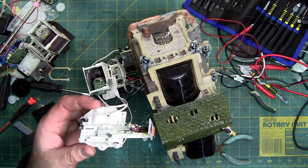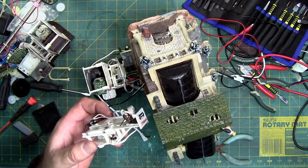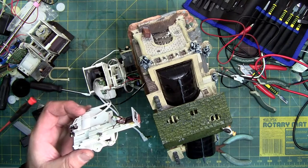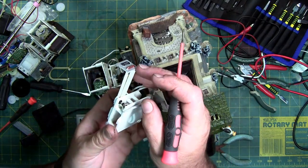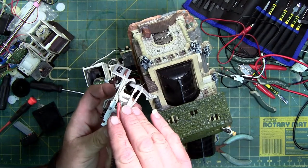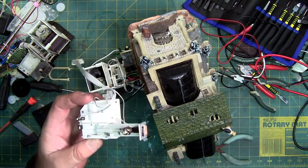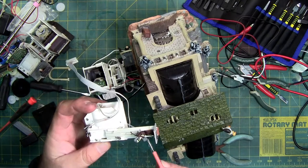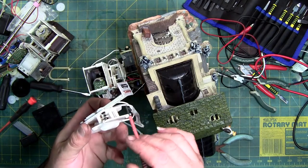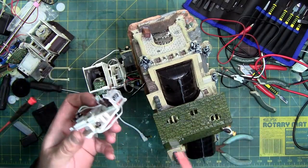Other causes that make this thing not drop and get stuck — very similar to the mortuary or graveyard with the casket — involve this slide. It's separate. Crap, grit, dirt, dust, hair, fur — whatever gets caught in here will bind it and stop the delay. Not as common, but it does happen. Before you tear it apart, see if you can spot anything in here. You also need to keep this lubricated. If this doesn't slide separately from the drawer, the dude doesn't sit back down.